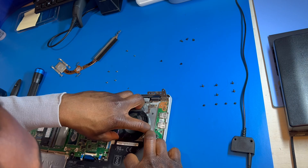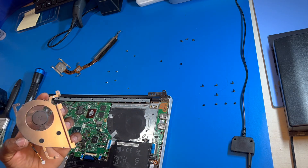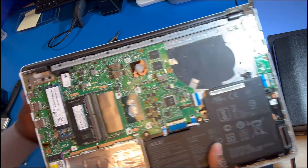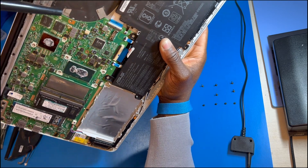First, I remove the heat sink, then I remove the fan. Now, the fan might be removable before removing the heat sink, but I plan to replace the thermal paste. If you take off the heat sink, you have to replace the thermal paste — you can't reuse the old one.